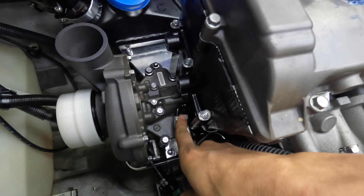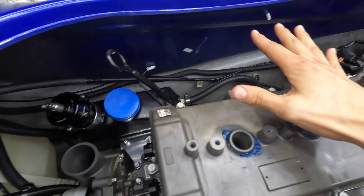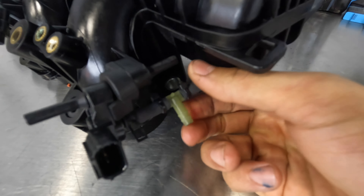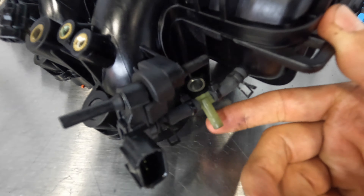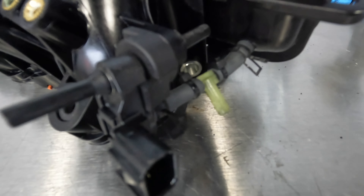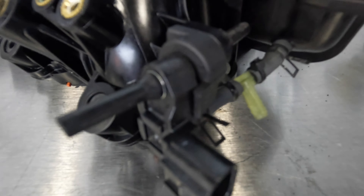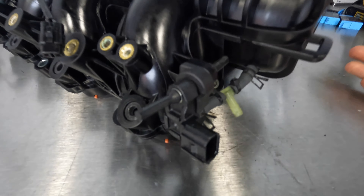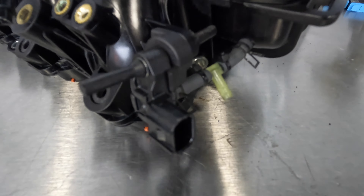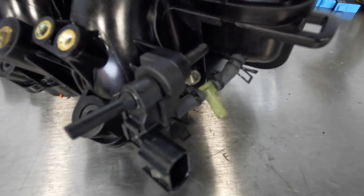Now that the supercharger is back in, you can see where the added oil line is for extra lubrication — and that'll wrap up the engine work. But before I put that in, I have to show you one thing: this ski had a blow off valve installed on it already, and the owner had spliced the vacuum line off the MAP sensor. You don't want to do this, because when you're in the sweet spot of the RPMs where the blow off valve is fluttering between open and close, it causes the MAP sensor to freak out and can even make it run lean. It's a lot smarter to pull the intake manifold off and drill and tap it. I'm going to put a link in the description to another one of my videos where I did the intake manifold upgrade and how to tap the manifold for a blow off valve.